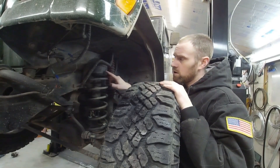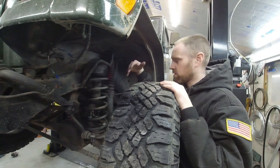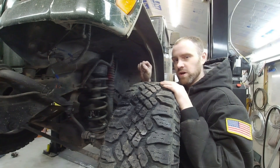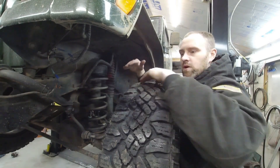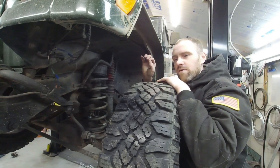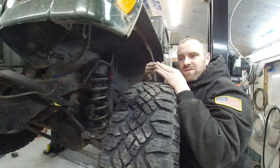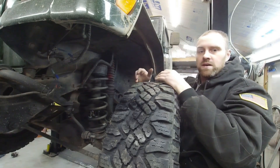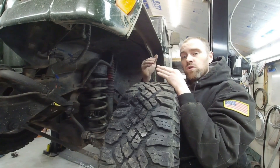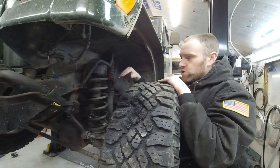This particular vehicle has a very small lift kit — probably two and a half inches or so. Lift kits on vehicles with that style of suspension, especially a really short wheelbase like this Jeep Wrangler, will actually make those joints fail more frequently, because they're flexing more. U-joints only have a very short degree of capability of flexing properly before they start to bind a little. It's normal for them to bind and they're designed to take the load of a little bind, but the more bind you give them, the shorter their lifespan — that's why they usually fail in situations with lift kits without changing the suspension geometry.